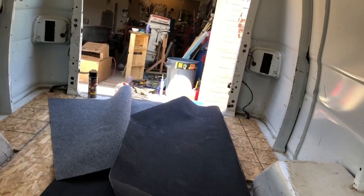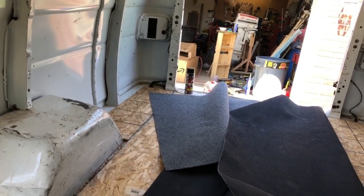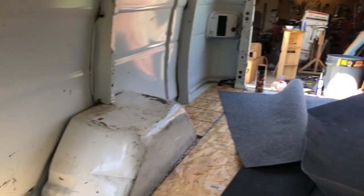Not all vans are the same — you may or may not have something like this intake for the gasoline. I just block out a measurement, figure how far I want it this way, where it is in relation from here to there, then guess it out, draw it out, and cut it out with a jigsaw. I've been using roofing nails — I don't put many in, just on the edges. It's mainly taking your board straight down the middle to the top, using two sheets, then cutting up the leftover parts. Once your wood is placed, nail it with inch-and-a-quarter or inch-and-a-half roofing nails, just the least amount you can get by with to get your edges the way you want them.